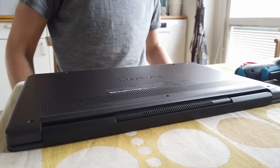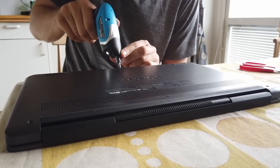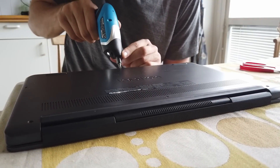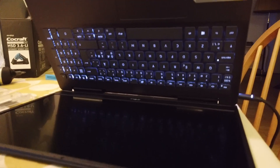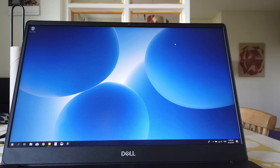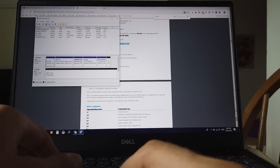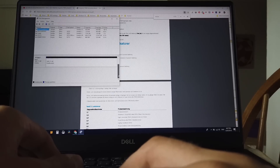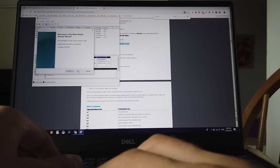Let's put together a few of these screws and then get into it. I couldn't even boot up the computer. The LED indicators next to the charge port were flashing 2 plus 3, which is an indication for some kind of memory issue. I removed the new RAM stick and it all worked fine. When I removed it and got into the computer, I was setting up the SSD to make sure that worked as it should — and that was all fine. Then I redid the whole process and still couldn't get the RAM to work.